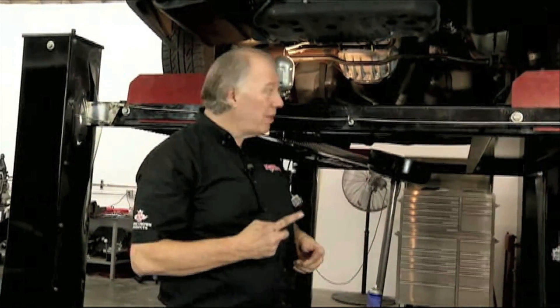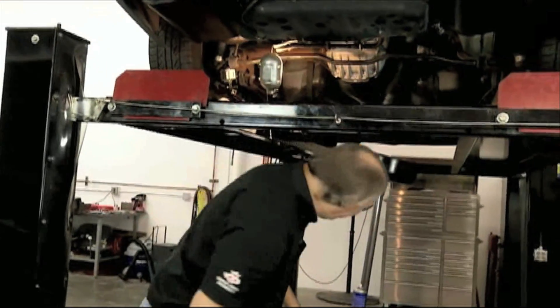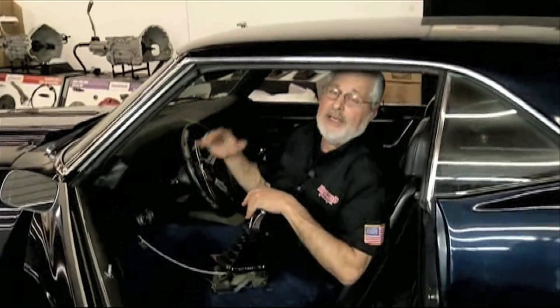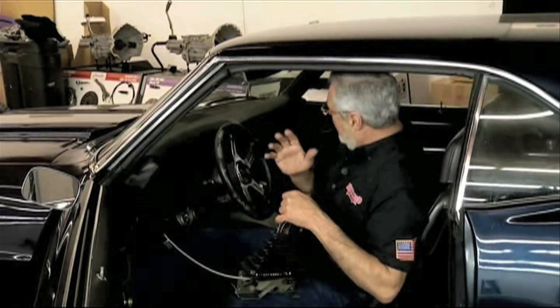Last thing I do — put in the fill plug. Before we do that, we'll fill it with fluid and we're in business. Our oil pan installation is all done, dipstick's in, and I've refilled the transmission. By the way, it took six quarts to fill it up. Now normally when you drop a pan with a shallow pan, three to three and a half quarts will do it. So make sure you check it good, run it, put it in park or neutral, and get it on the right mark.